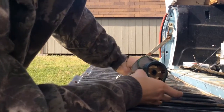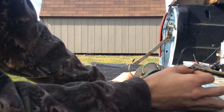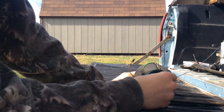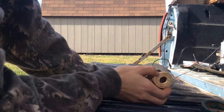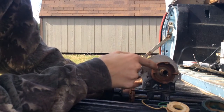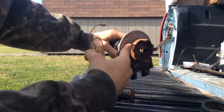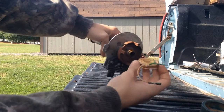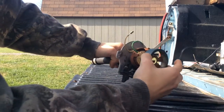Mine's off an '89 - mine had a square clip. Whatever one you took off, put that kind back on. There'll be new ones with the kit. There's a little copper housing piece, pickup coil, and then there's this little pin in there. When you put it back together, if you take this piece off, make sure you put that pin down enough so that the new pickup coil sits nice and flat, nice and flush.